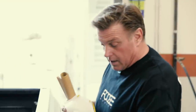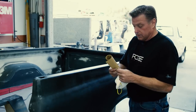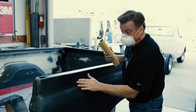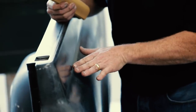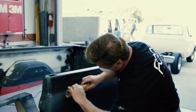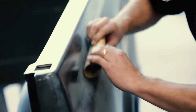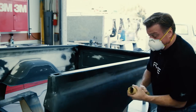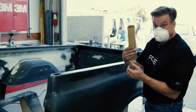One of the things I'll do on an undercut or a reverse radius is I'll just roll the sandpaper to make my block with that — I'll show you how I can control that inside that negative curve. The black primer has a little bit of gray primer on top of it, and that's called the guide coat. As I start to sand, if there are any low spots, the guide coat will stay down in there — I'll either sand until it's gone or put a little bit of spot putty in there. You'll see that roll of sandpaper follows the contour of that radius. The rest of the bed I did with the Festool and the DA sander on all those flat panels to keep them real clean.